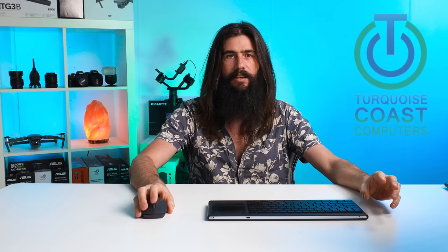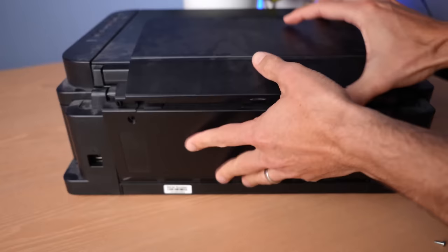What the printer manufacturers have done — and in Epson's case they seem to have created a feature on the printer where it flushes and purges ink a lot more frequently — to deal with this increased chance of clogging and blocking of the ink pipes that run up to the print head. And this is where we get on to this maybe not just being inefficient but actually being an outright scam. These Epson printers have been fitted with a device in the back which is essentially an ink sponge. Because these printers have to purge and waste so much ink to maintain the heads from becoming clogged, that ink has to go somewhere. They obviously don't want the users knowing that they're buying ink that's just being squirted out the back of the printer into these ink sponges.